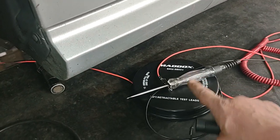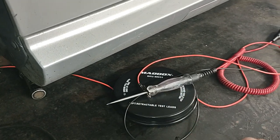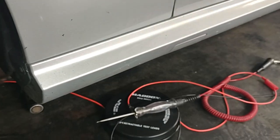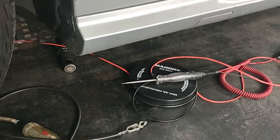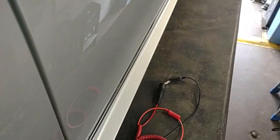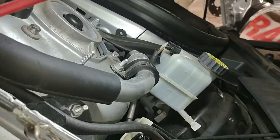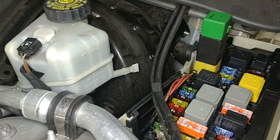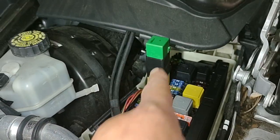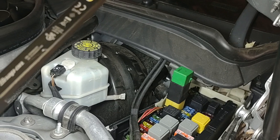Here is my red wire connected to the start wire on the starter, and I have a test light here. This test light very much simulates the starter right now — when you turn the ignition to the start position, this light is supposed to turn on. I'm going to do it in two ways. First I'll go to the relay and trigger it. Here is the starter relay — I have my own adapter for access — and I'm going to ground it.